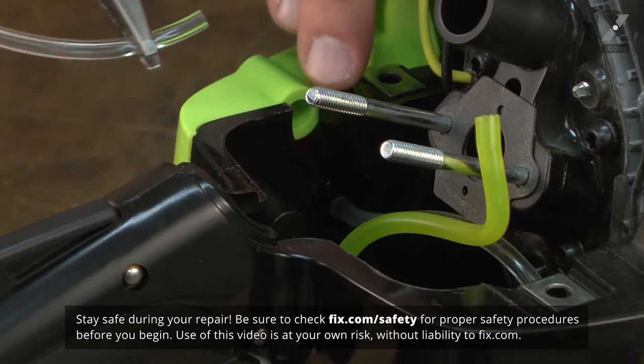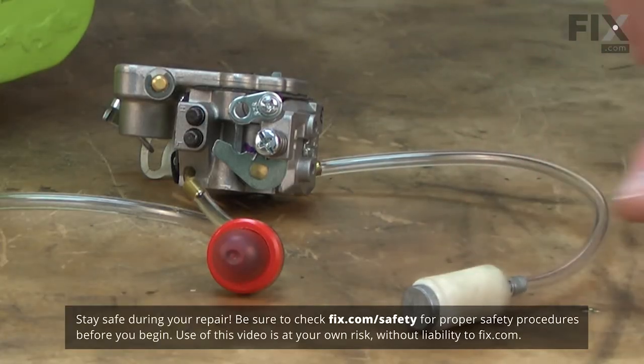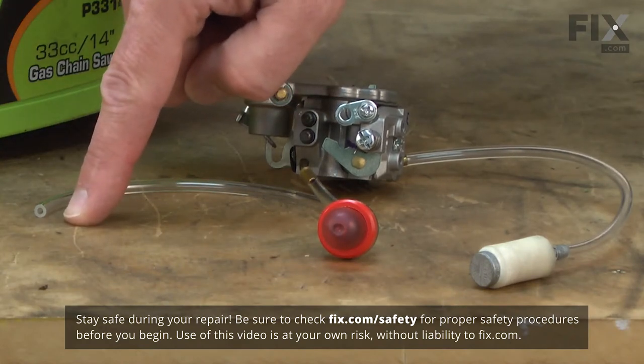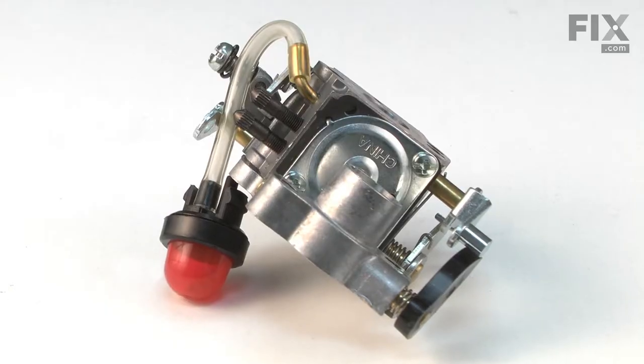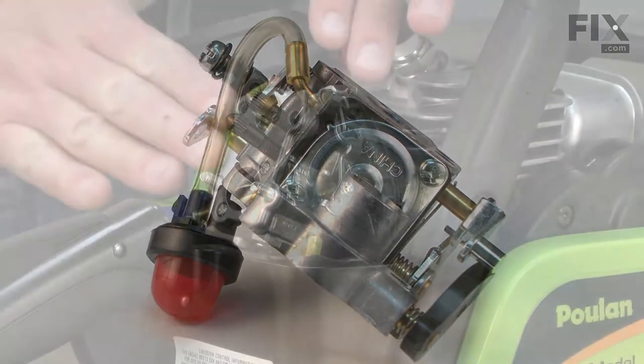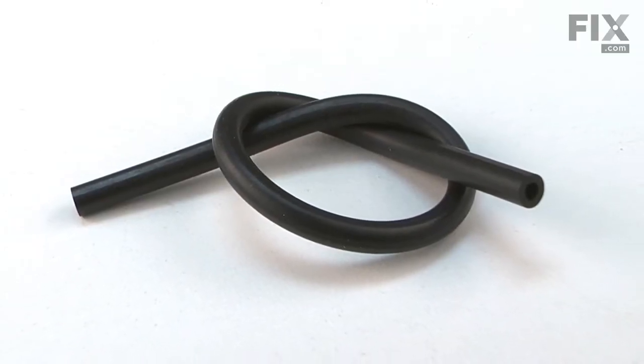There are multiple fuel lines found on most small engines. At a minimum, there will be a line carrying fuel from the tank to the carburetor, and a second returning excess purge fuel from the carb back to the fuel tank. Many models have a remote purge bowl, which adds a third line between it and the carb. Some models will have a remote tank vent, and another piece of fuel line connecting it to the tank.